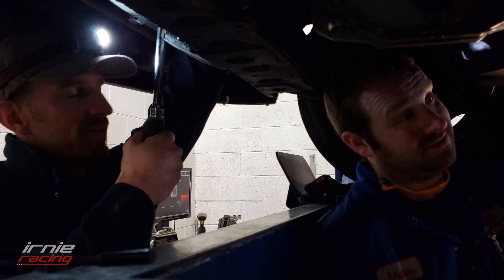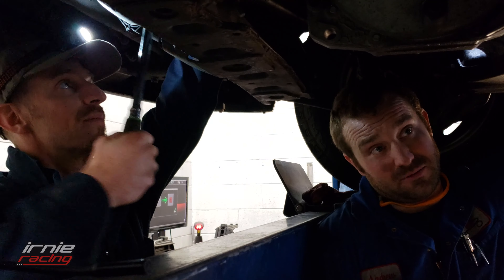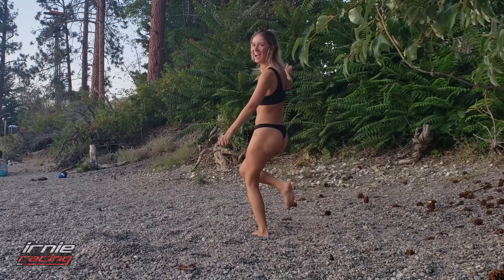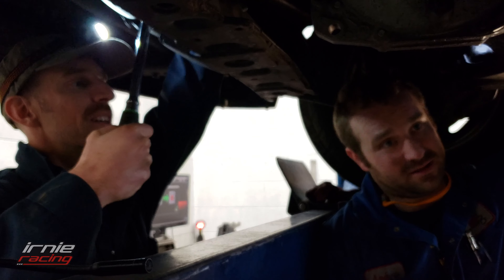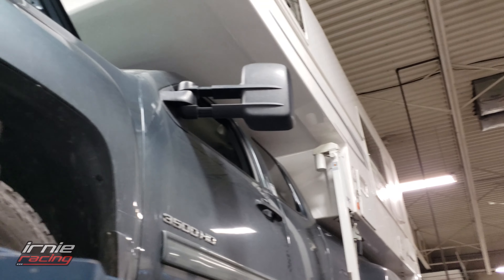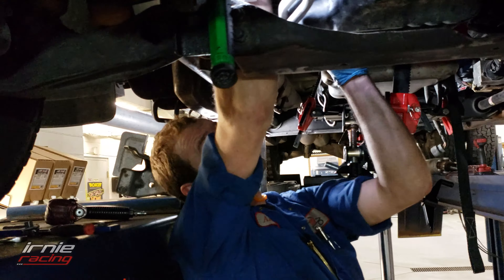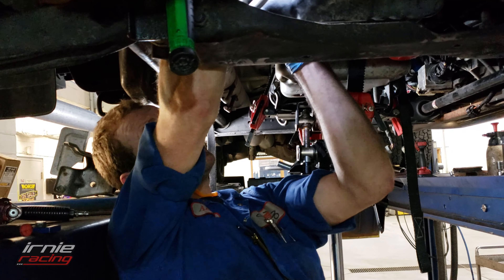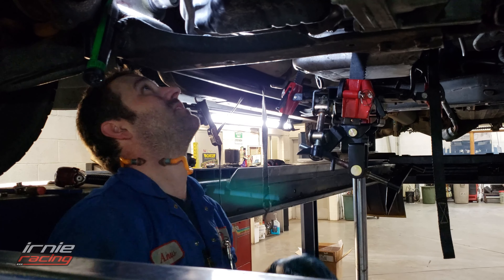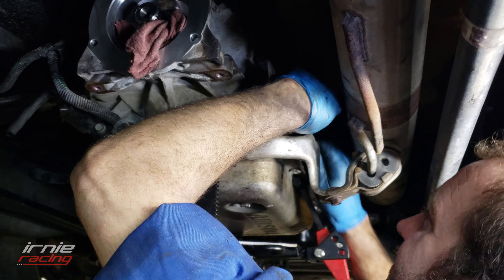More paper in the bell housing for anti-knock. Rotating the crank to align the next bolt position — there it is, right there, leave her right there, that's perfect. Last one, number six. Update: all the torque converter bolts are in and tight.